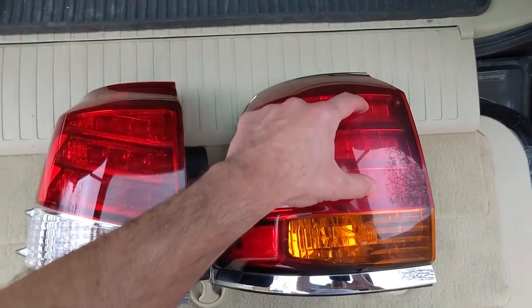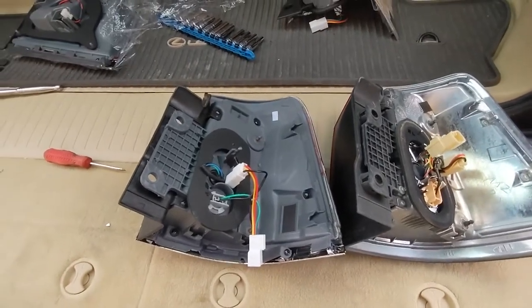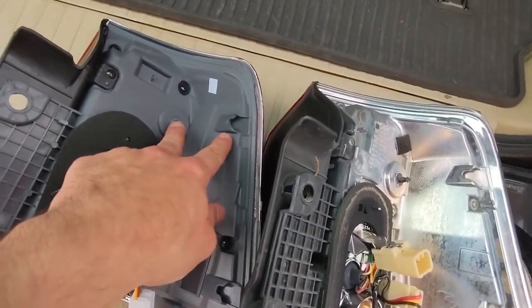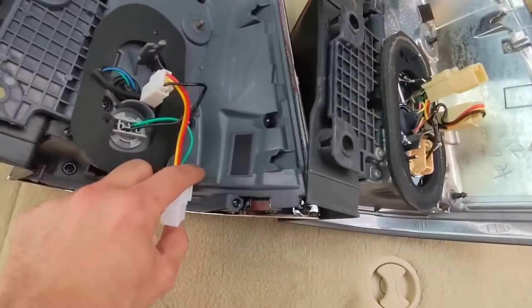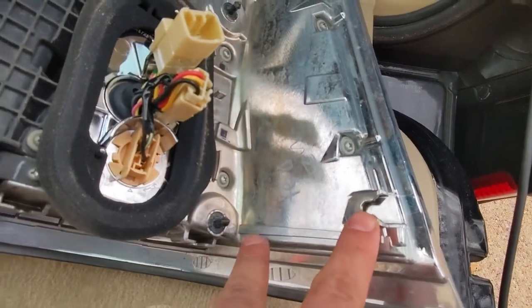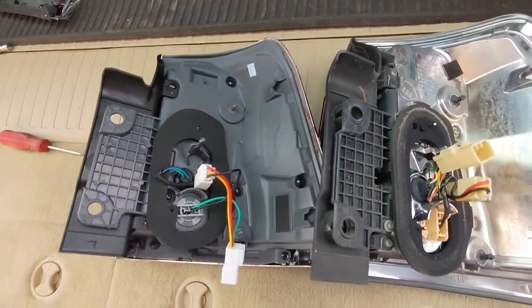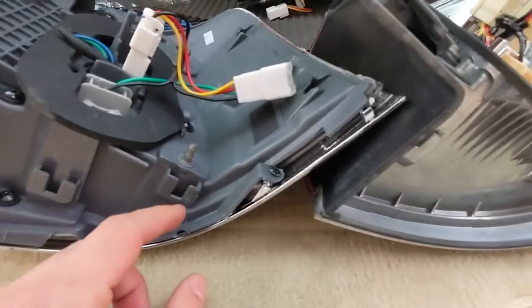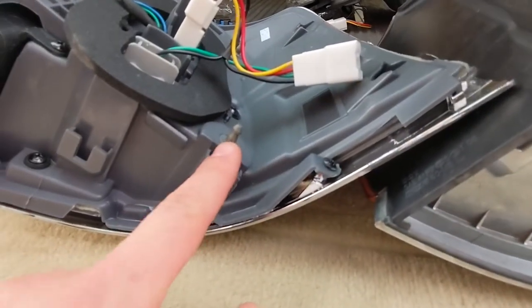You can see the pin is going horizontally versus at an angle. I found one thing that's very different — just different enough to where it does not fit up. Let's compare: the distance between the mounting points is similar side to side and up and down. The location of this pin and this one: identical. The bolt holes: seemingly identical. But can you spot the difference? See where that pin is in comparison to this tab?